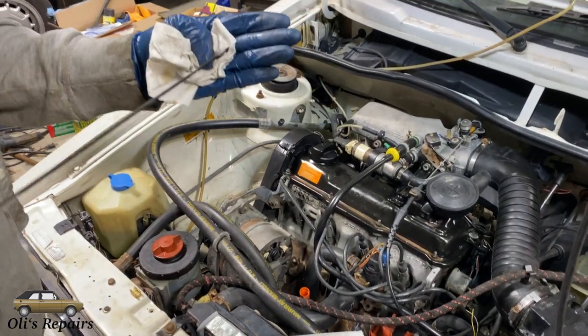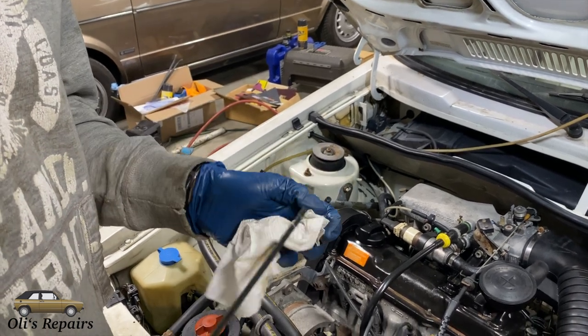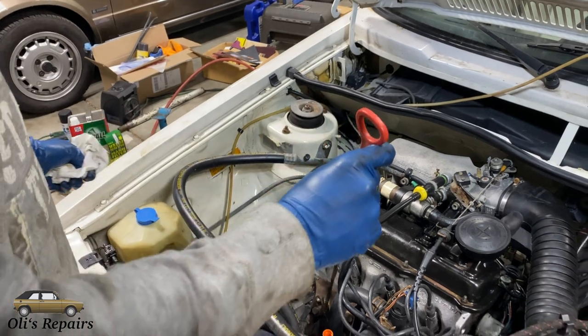The engine oil pressure light ended up coming on again once I revved it above approximately 3000 RPM, but the gauge is indicating approximately 4 bar. That indicates there is a problem with the high pressure sensing circuit which will be fixed in a later video. Finally, one last oil check after we ran the engine — make sure it is above at least half and top it off if necessary. We are just under the halfway mark so I am going to top it off just a little bit.